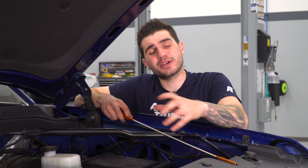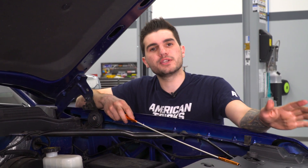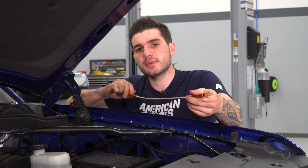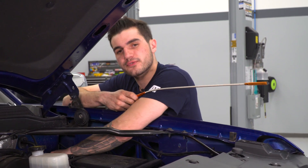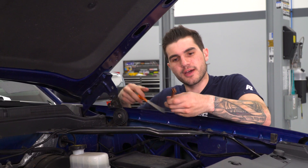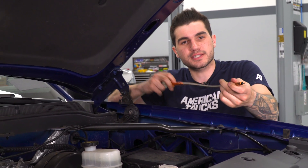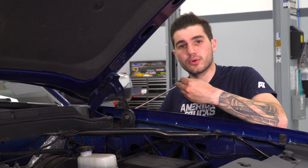This is a really hard install to show because of the very tight spaces, especially in the cab. You can do it with a wire coat hanger or a flexible tool with a little wire grab on the end. I went in from inside the truck on the driver's side under the dashboard, fed the tool up through the second hole right behind the fuse box under the dashboard. Once you get through that second hole, you can have a friend feed the wire into the grabber, close it up, and pull it through to the inside.